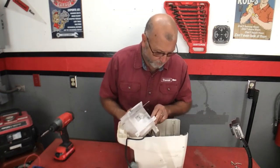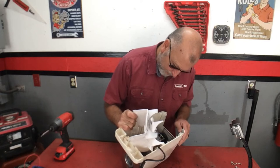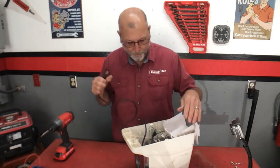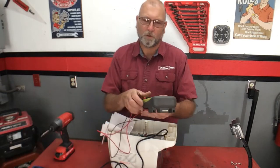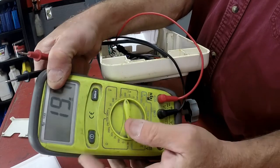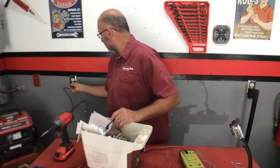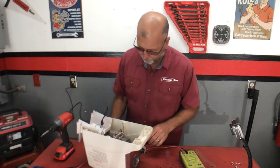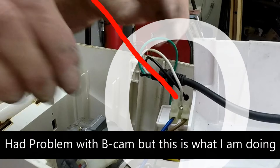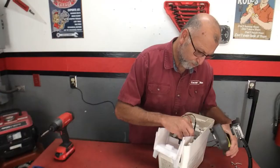The first thing I'm going to do is turn this wheel and see if the motor turns over — and it does, so that's okay. The next step is to actually see if we have some voltage. It could be as simple as the power cord, so I'm going to plug this in and take my multimeter, turn it on, put it on AC voltage, and see if we're getting voltage to the terminal block. And I am — I'm getting the proper voltage, so the cord is okay.